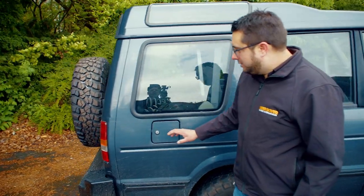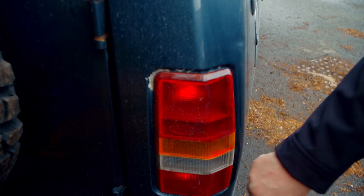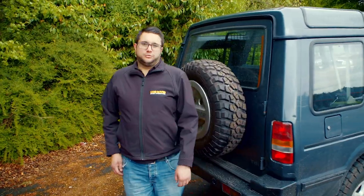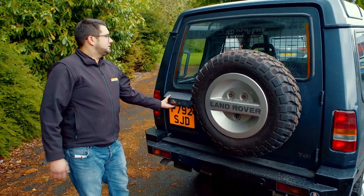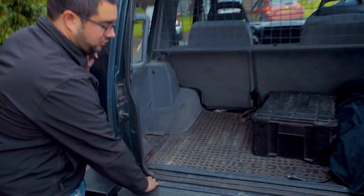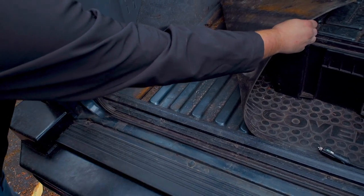Moving around to the back, checking the bodywork as you go, there's more electrolysis around the rear lights — they're quite bad for this. Paint chips off and it just looks scruffy, so again not a massive problem if you're going to use the vehicle off-road, but if you're looking for a really nice original one you want to avoid that. Moving to the rear door, because these have the spare wheel on the hinge it's under a lot of stress, so pop the back door open and give it a little rock to make sure there's no play. Look inside the shut line for rust, and if the seller's happy peel up the mat in the boot and check for rust in the boot floors as well.